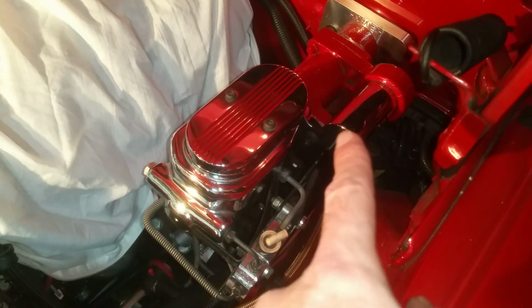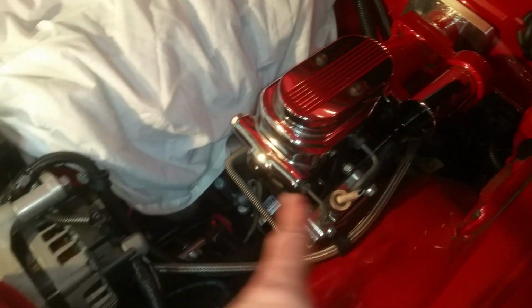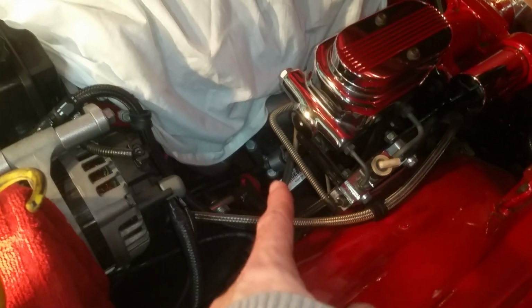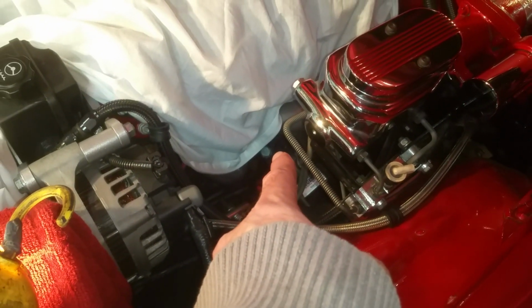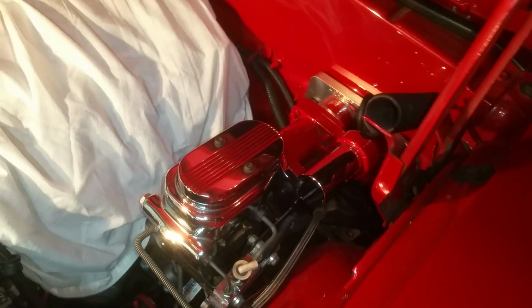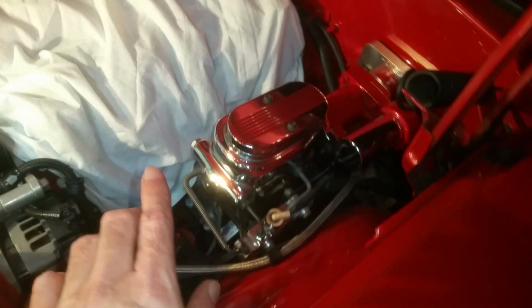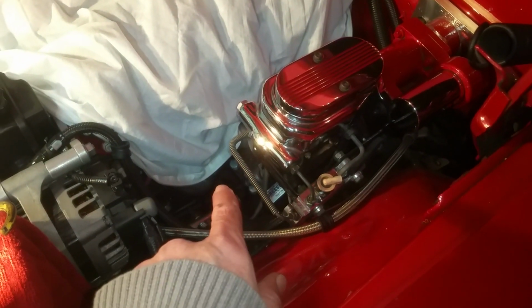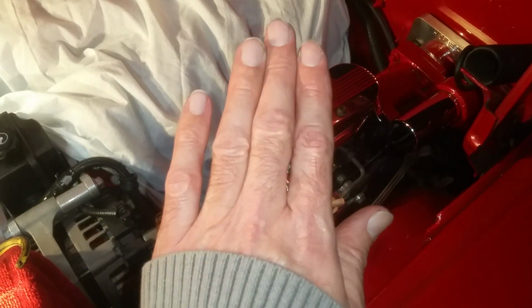When you let go of the brakes, whatever fluid is flowing through the HYDROBOOST will flow into the reservoir. But if you have the power steering box connected, all of the flow that's coming from the power steering box is going to impede the flow from the HYDROBOOST return line. And what's going to end up happening is you're going to have a slow return on your pedal. You hit the pedal, and normally it should just come back up so you're ready to hit the pedal again. But if you have it teed off, the pressure coming off of the power steering return line is going to slow down that pedal from coming back up.